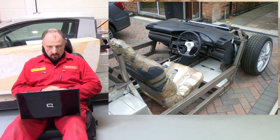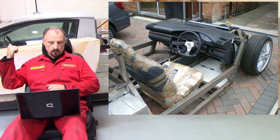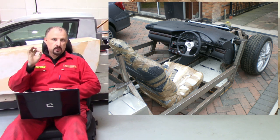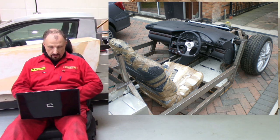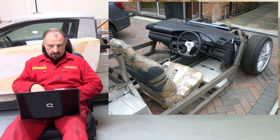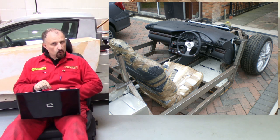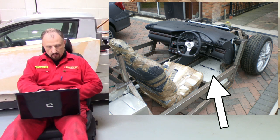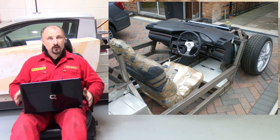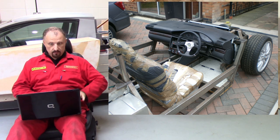Here's a close-up of the dashboard. This picture should give you an idea — the dash, steering, pedals and everything are mounted to the chassis. It's super strong. It is not mounted to any fibreglass. You can see there's a white board in there — that's a temporary board so I could mark up the pedals. There's a strip with two black markings — that's where my heels are so I can get heel-and-toe set up with my pedals. But I'm getting ahead of myself; we'll do that in another episode.